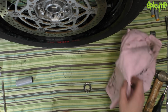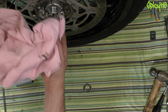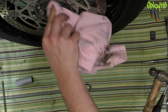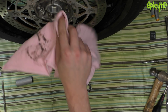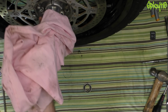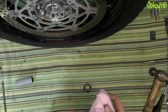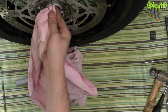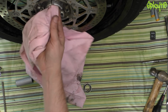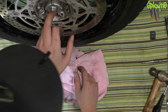So it turns out a tiny wincy bit of heat really made all the difference there. So what I'm going to do to seat these bearings is heat the seat up a little bit, because it's alley, so I think it's alley, so it expands. And then the cold bearings can be dropped in without too much resistance, and you won't have to beat them in, in theory. But you do need to clean the seat of the bearing out right down into that corner.